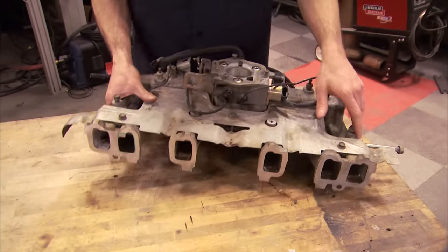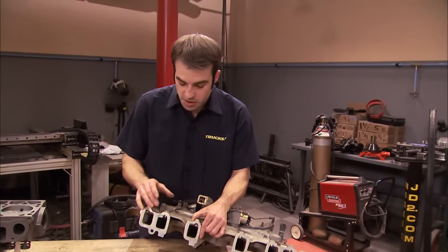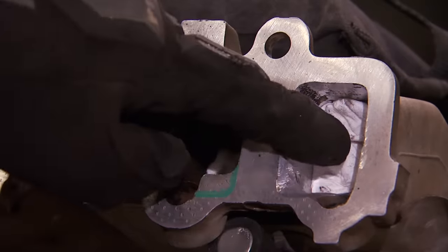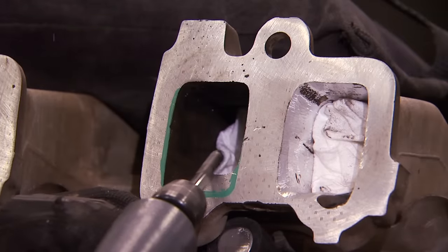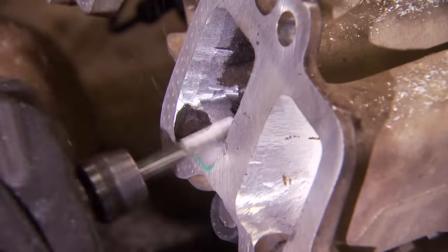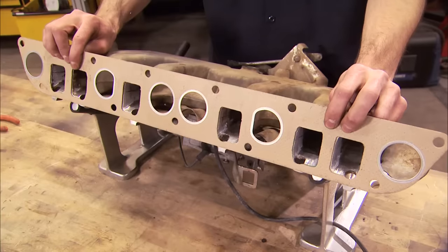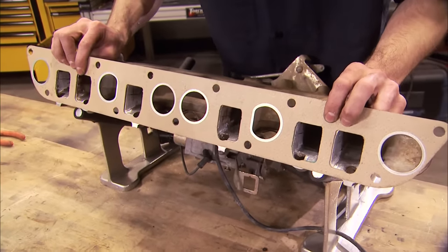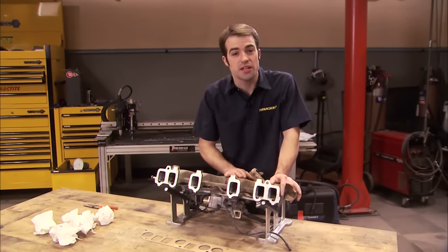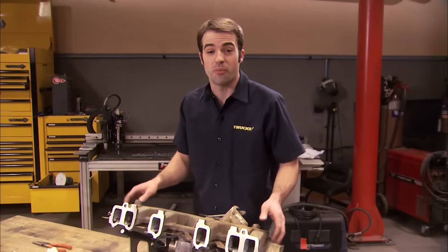Over here, you can see I've already been working on the intake runners of our old manifold. Because our new cylinder head has a higher port design which flows more air, we just have to make sure these ports line up for a nice smooth transition. This burr is specifically made for aluminum with much wider flutes, and we've stuffed a rag down in the intake runners to avoid getting debris into the intake manifold. With aluminum, you're going to move a lot more material a lot faster, but we're basically using exactly the same technique of gasket matching and tapering into the runner. Our intake manifold runners now line up almost perfectly with the gasket, and that means we'll have nice smooth airflow from the intake into the cylinder head. By gasket matching the intake and exhaust runners on the cylinder head, along with the combustion chamber work, we're going to pick up a fair amount of horsepower — and for basically free.